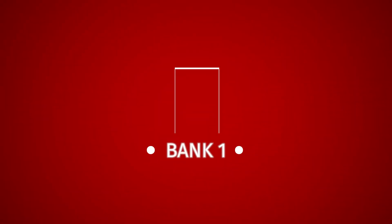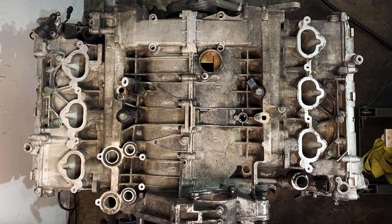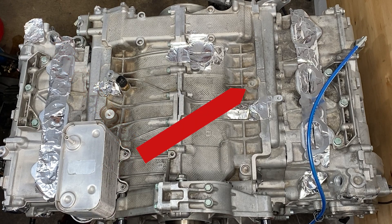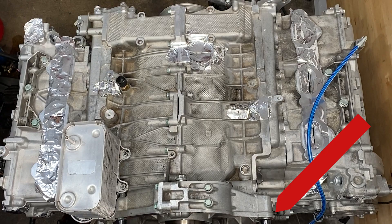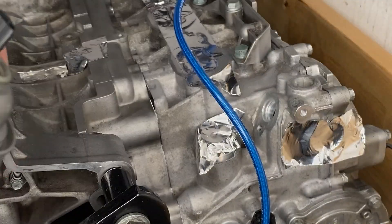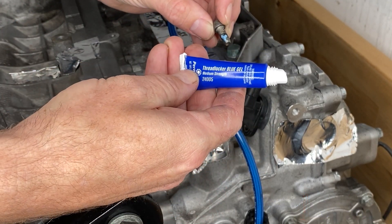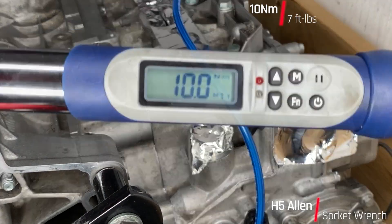The camshaft position sensor for bank one — let's start with a bird's eye view to get a lay of the land. Here's what it looked like before cleaning. Here is the camshaft position sensor for bank one, bank two is over there, the knock sensors are bank one right there and bank two on the other side, and the crankshaft position sensor is just there. We spray electronic cleaner on all these electronic bits, then fit a new O-ring — we had to buy a special one from Porsche as it didn't come in the gasket kit. New thread locker from Permatex — it's a gel with a blueberry smell, which is a little odd. That's an H5 fitting torqued to 10 newton meters.